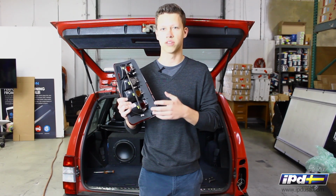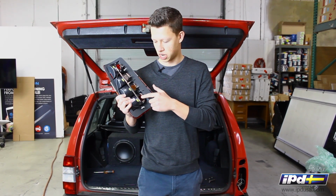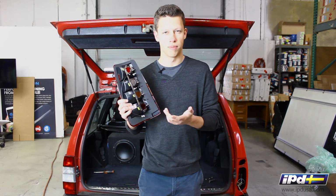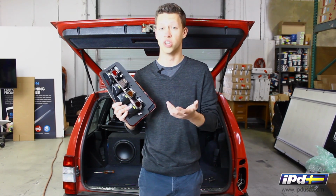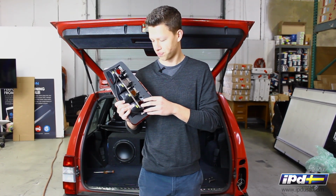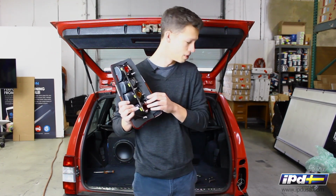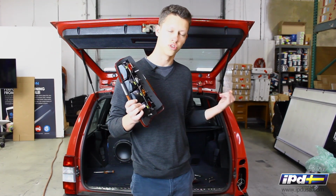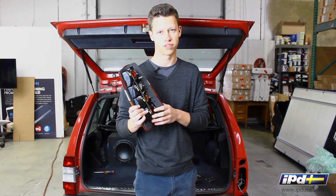It's really annoying. This is a common problem. It's really just a poor design from Volvo where this builds up. This is common on either factory taillights or even aftermarket ones that we sell. Even a new one, you can see this. My actual Volvo behind us, this '91 740 Turbo, is having this problem, so we're actually going to show you how to address this with a really simple wiring swap.